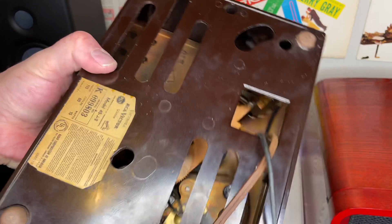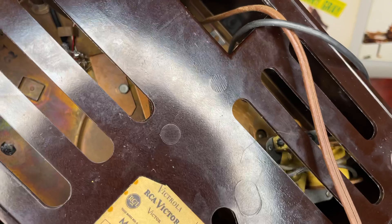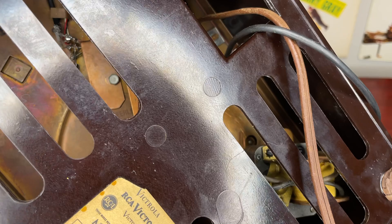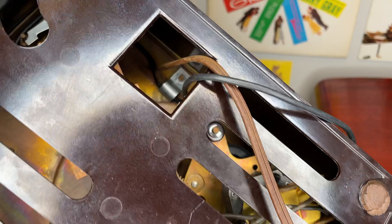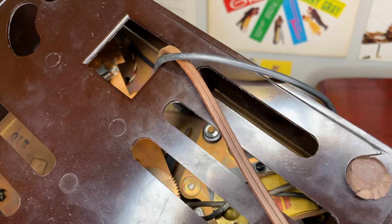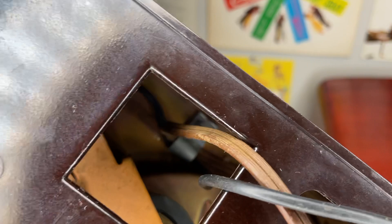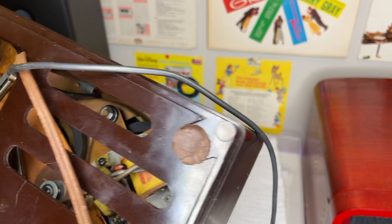Looking on the bottom here, this is the 45 J2, and you can see inside there — what does that say? Peerless enamelwares. Cool, that's really neat. That's stamped on the bottom back there, that little circle back there. That looks like bronze, or whatever material that is. There's a power supply — it's just like a clock, it's truly amazing. I don't know if that wiring looks modern or not, but I feel like I'm going to have to get in there and do some work on this because it's pretty loud. The motor's loud. You can see the idler's got a little lumpy spot there — the camera doesn't want to focus in the right spot — so I may have to rejuvenate the idlers. There are two idler wheels in there.